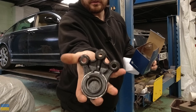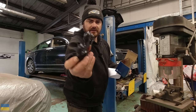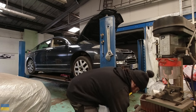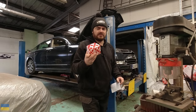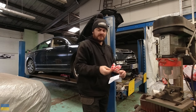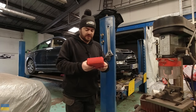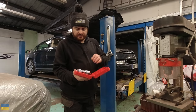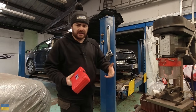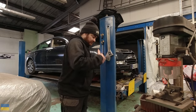This little box of tricks — believe it or not — is a ball joint. It doesn't look like it; it looks like a frog's footprint. But there's a bearing in there and it presses onto the bottom of the knuckle and pivots on that. I did also think the top might have gone as well, so I've got that too. And then there are some bushes in the uprights which I had to do. I had to buy a special tool to change those bushes — they weren't actually on the advisory, but they do tear through them.